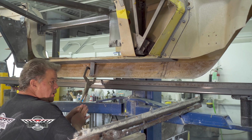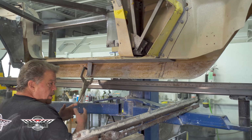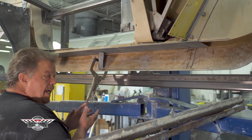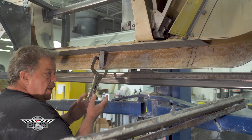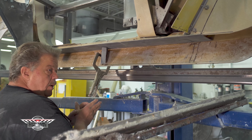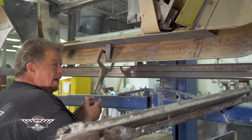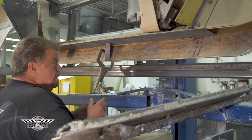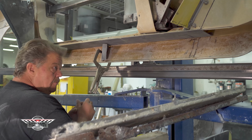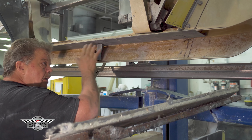It's kind of like the fifth, sixth, seventh, and eighth generation of a Corvette. A monocoque design. They don't talk a lot about it, but if you ever get inside of one, you'll see how it is built. Everything is bonded together. Everything is interlocked together. The frame of a newer style Corvette, the floor and everything is bonded to that frame. You can't pull the body off the frame of a newer style Corvette. This we're designed so we can still take the body on and off of the frame. But it's still going to have that same monocoque design that holds this car together.